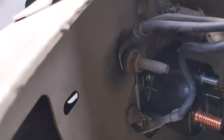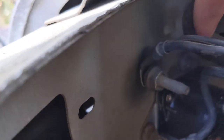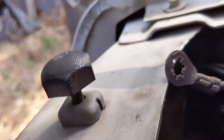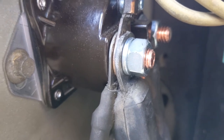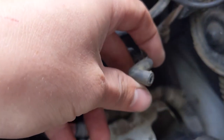To put the ground back on you need a deep socket — a 7/16 is what I used to get it tightened. Put the double cable with the two wires in on the bottom, and then the single ground goes on the top with the nut on top of that. Got the grounds back hooked up, now to reconnect everything to the starter solenoid. Got them both back on. The two yellow wires that come above and below — one feeds the power distribution box, and one goes back into the engine as power to the starter. These came with lock washers, which is good since the last one didn't have those and it did seem loose. Got those tightened down.